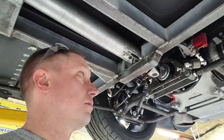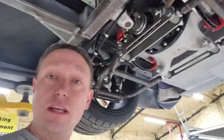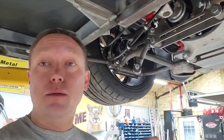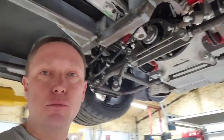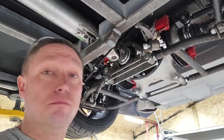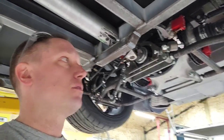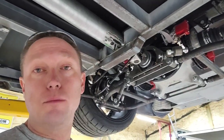That made me realize I needed to run a couple of these parking brake calipers so I'd have some extra ability to stop the car. I am running a dual master cylinder, so you'd like to think you've got three ways to stop the car. The first thing I learned: your parking brake cables come in one of two fashions — the cable either has a round ball on the end or a barrel. I started off by ordering the wrong cable and discovered the hard way that the supplier does not accept returns. So make sure you order the correct cable for your car.